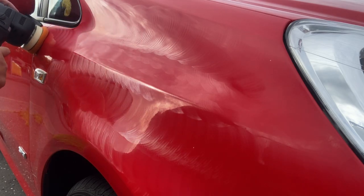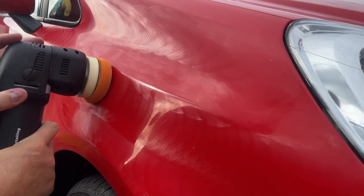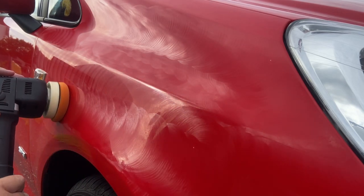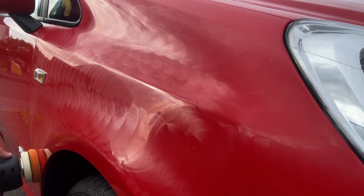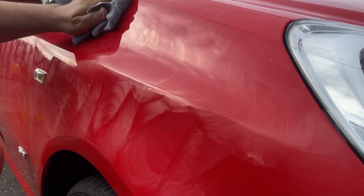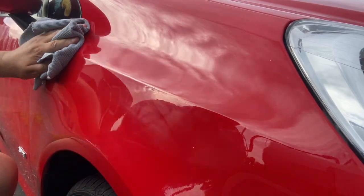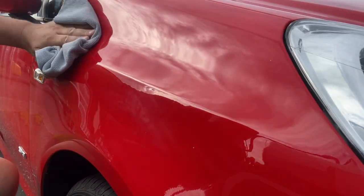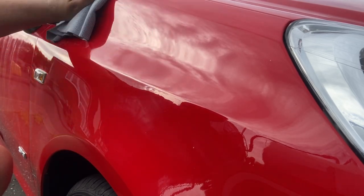To be quite honest, the softer pad and the slower speed really does work quite well together - the polish remains oily and you've got all the time in the world to work it. I'm only going to show you this front wing, as the video would be over an hour long otherwise. Let's get it buffed off and check the results with the light. I'm using Korean pearl weave cloths from Into Detailing - they're great general purpose cloths for removing waxes and polish residue. Hopefully you can see a rich deepness to the paint there after buffing, so the true test will be the swirl finder light.